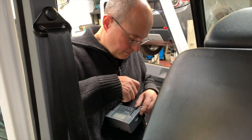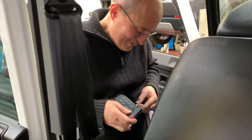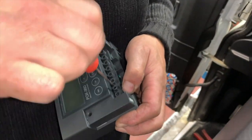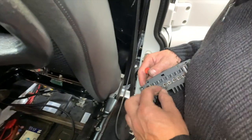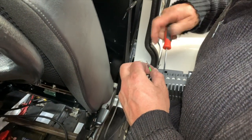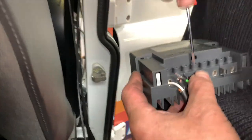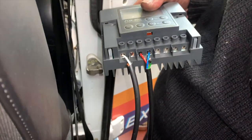The next thing we're doing here is connecting the cable coming from the solar panel into the charge regulator. It is very well indicated where the cables go in the charge regulator. And what we're now doing is plugging in the battery to the charge regulator. By the way, don't mind the green cable you see there. As per the battery, it's always plus and minus. The green cable there was an extra cable that we had found, so the green cable was then cut. Please do not use three cables, only plus and minus.